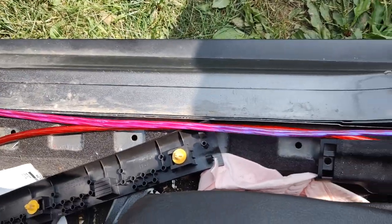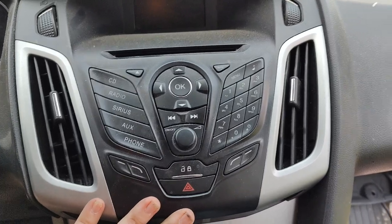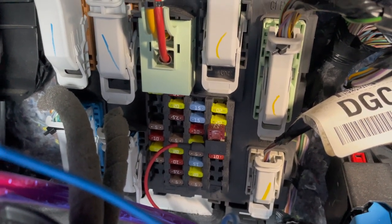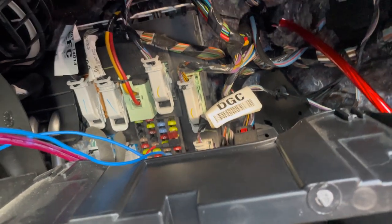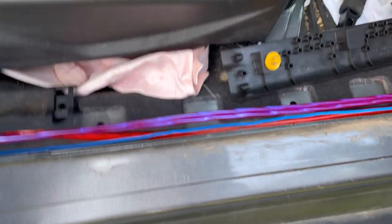So the power ran through here, down along here, through here, and then we're going to run it in between the seat. We've got RCA cables coming up right now. We're going to pull this plate off and get into the head unit to hook up our RCA cable adapter. The other phone I was recording on died. We've got the radio back installed — under here you can see the blue wire is the remote that got ran to the RCA adapter. We did an add-a-fuse here — I believe it's the window motor, so it's key-on switched. If the radio is still on and the key is not on, you're not going to have subs, which is okay with me.